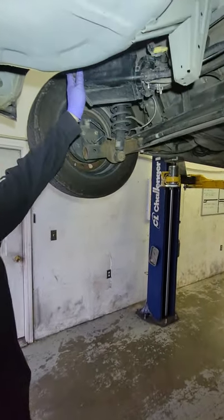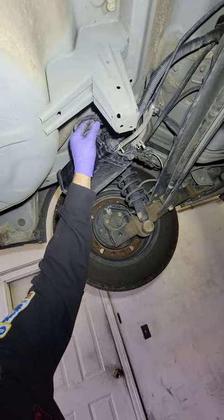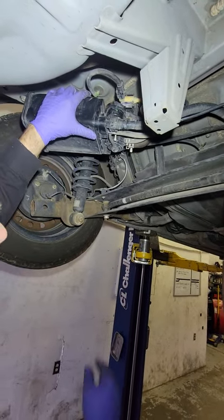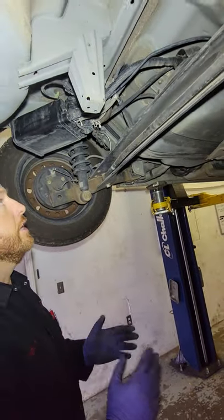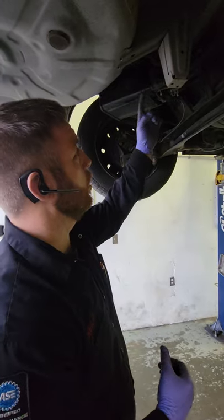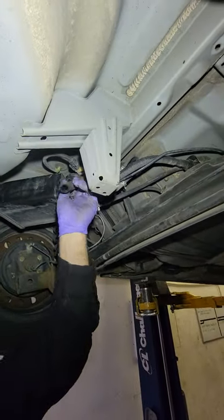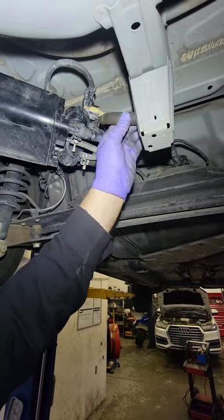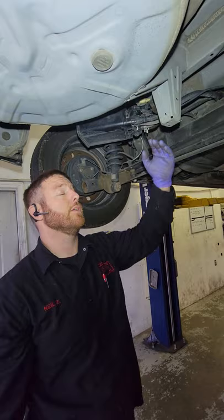This is the charcoal canister assembly on this one. It does not have the leak detection pump on here — it will be mounted on the side with an electrical connector going to it. It does have vacuum switching valves here. It's a charcoal canister vacuum switching valve, and you have some other valves hooked up — looks like a vent valve, the tank, and diaphragm valves. You've got to locate the vent hose — that's venting the gasoline vapors coming out of this charcoal canister. If you follow this hose, it goes right here inside this little bracket. You can see it's actually a little bit wet. They do that so any fumes going through the charcoal canister get absorbed, and it vents away so people don't smell it.